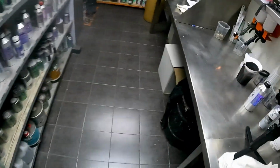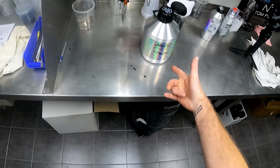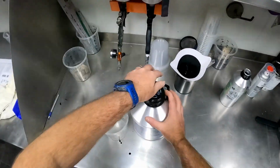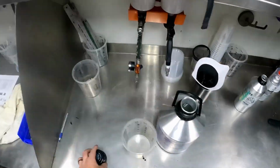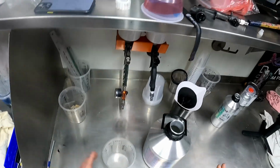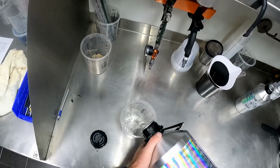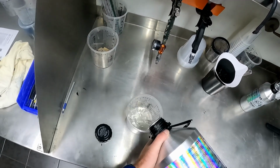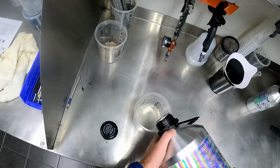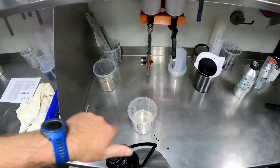So we've got the epoxy on those two little fenders. Time now to mix up the custom clear. So 4:1, slow hardener. We want to slow everything down, make sure that clear coat flows right out. It's going to look sick. So I want to be clearing the inside and the outside of that guard, so we'll probably just go up to the 2. If I need to mix up a little bit more, I will. But yeah, so there's clear.